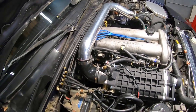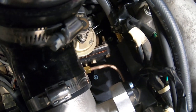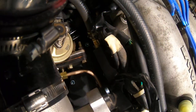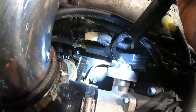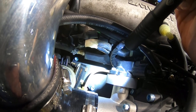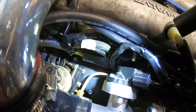Those solenoids then have a line that goes back here that we ran over to the EGR valve itself, which we showed in previous videos — that gets relocated because normally it would be attached to the intake manifold itself. So you can see it down there on that little plate, and then the plate attaches — you can see that brass hose there. That brass hose goes directly into the supercharger, so the exhaust gases basically can flow through there. That was kind of a pain to deal with. It's mounted using a hard line, and the hard line that the kit provides didn't quite line up the way I wanted it to. So what we ended up doing is using quarter inch brake line, since it's a quarter inch diameter tube. It was a little easier to bend and shape, and I could make it as long or short as I needed, and that made life a lot easier.